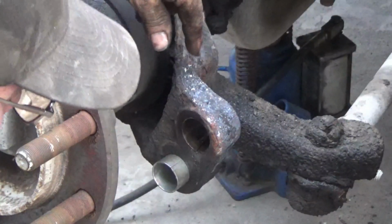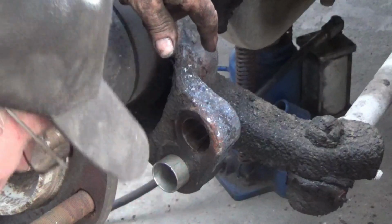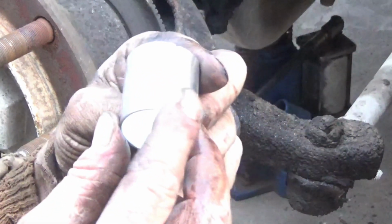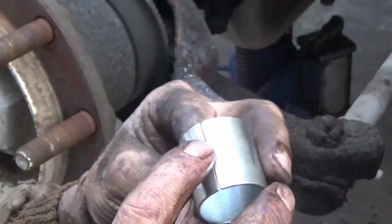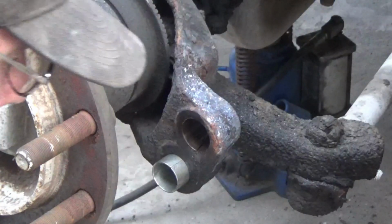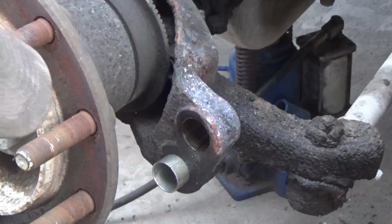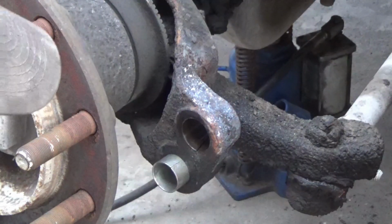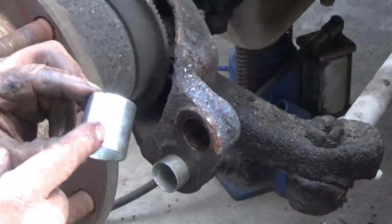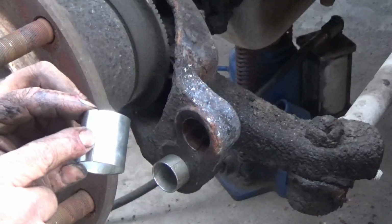And my personal preference is to have that gap in the bushing. The gap that's in the bushing, here it is. I like to keep that on the top because so many times I got to use a Sawzall to get it out. Well, with a Sawzall you want to cut down. You don't want to hold the thing upside down and cut up, because you want your cut to be on the opposite side, or at least a pretty good ways away from that cut there.